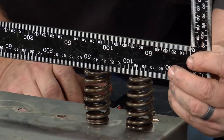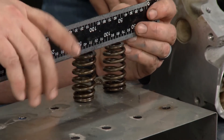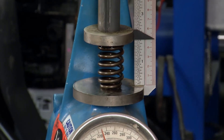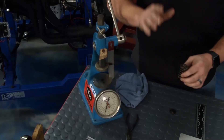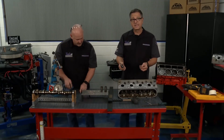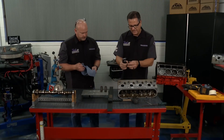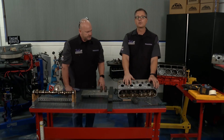You're looking for plumb. Now if you want to get crazy about it, throw a level on there — you'll see the bubble. These actually look pretty good. The final step would be a load test. You probably don't have a fancy tool like this at home, but there are specs here. If you want to load test every single one of your valve springs, you'll have a really good idea of what condition you're putting that head back in. And your valves — once again, another specification. You can come here and set your thing up as a no-go gauge — check it, check it, check it. Check your inside clearances. Just make sure all of your things inspect so your car will run great.